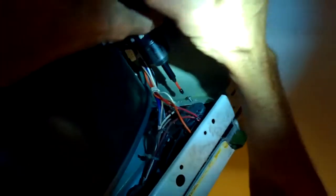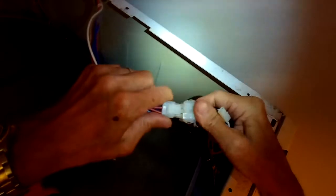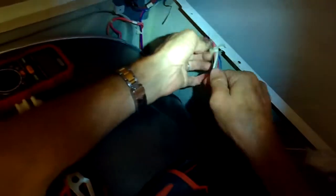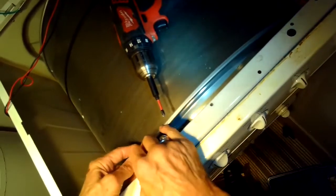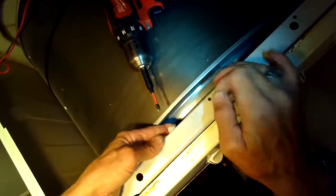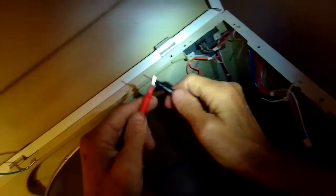It's a really common problem with this machine that the gas coils wear out — the machine won't heat very well, and eventually it will stop heating because it can't keep the gas flowing. I'm putting that connector back together. You've got to remember to add a zip tie to hold it on the frame away from the tumbler. Go ahead and put the little retaining piece back in that helps keep the tumbler from falling out — it's not critical that you remove this for this procedure, it's important only if you're going to remove the tumbler.